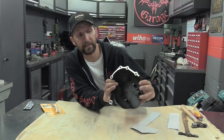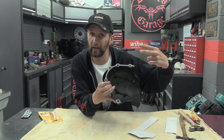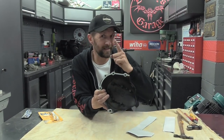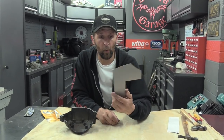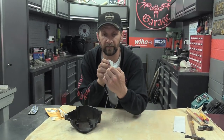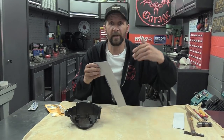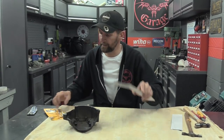You can see how complicated that is, all the shapes around there. If you had to buy an exact gasket for that, or tried cutting that with scissors, you just wouldn't do it. This is the easiest method. Take some cereal box card or any bit of straightforward card you need. Just not the corrugated kind, it's got to be solid card. The stuff in the back of a shirt when you buy one is brilliant. Or as I said, cereal box. Take some of that first.